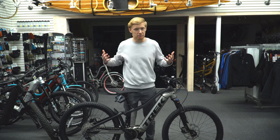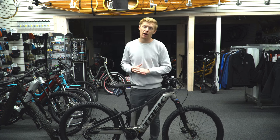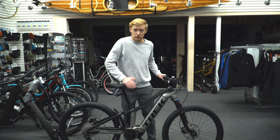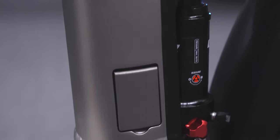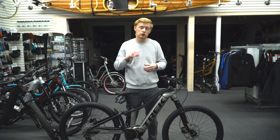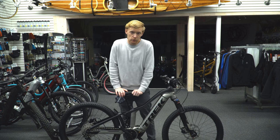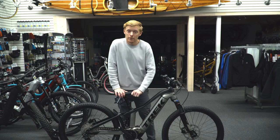Overall it's becoming a better mountain bike. One last feature really beneficial in mountain biking now is the dropper post — an adjustable seat post. Best explanation: it works like an office chair. When your weight is on it and you push the switch it goes down; when your weight is off it goes up. If you keep the switch down it always wants to come back up. I've had many people take the Powerfly 4 and put on the dropper post — they're about $325. There is some install cost as you have to drop the motor and it's tight routing, but it's possible on the 4. With the FS4 it comes included, ready to go, and it's a feature many people cannot live without — on regular mountain bikes, electric mountain bikes, anything really.